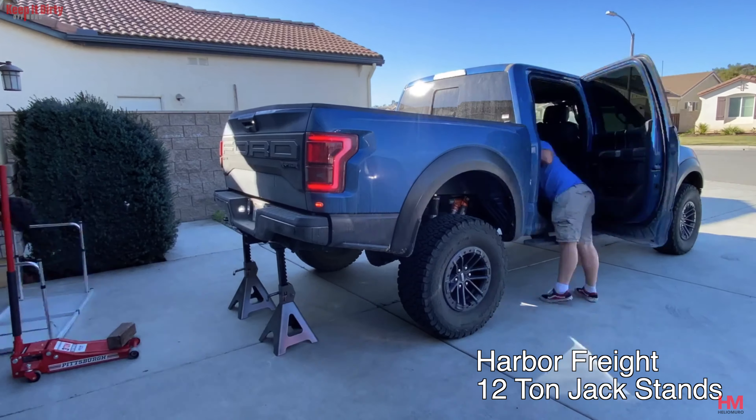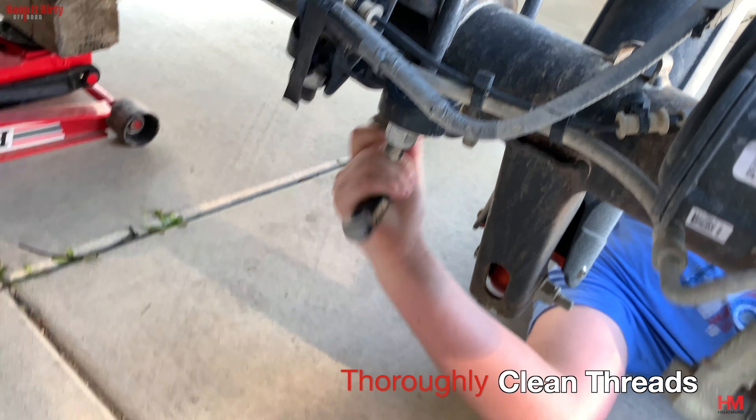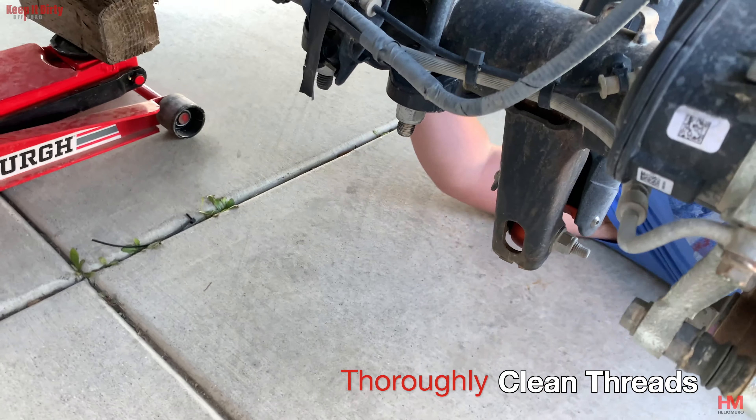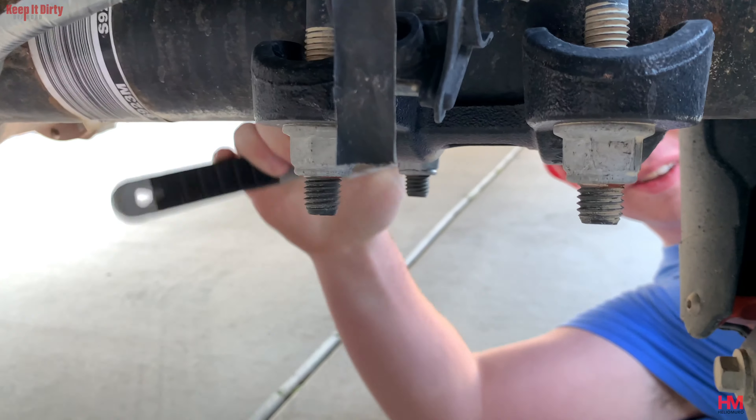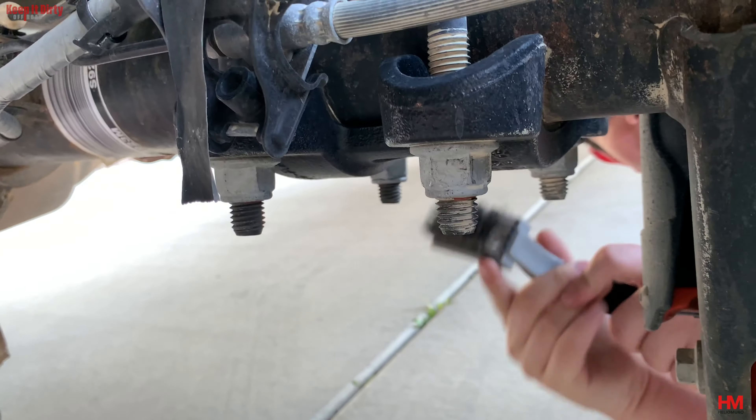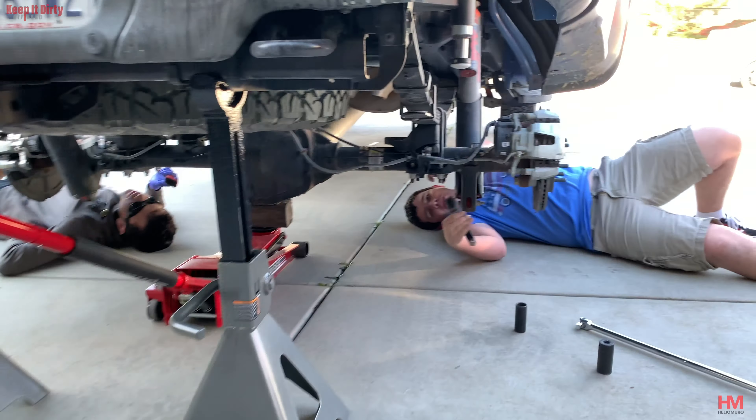Now, there are a lot of reasons why you guys would want to upgrade your leafs. But if you've seen our last videos on the live valve review, you definitely need to get rid of those stock leaves as soon as possible because they're not that good — they're going to cause some problems. They cause a lot of wheel hop. We just want to get rid of most of that and upgrade our leaves, and at the same time we also don't want to be dragging the butt of the truck too much.